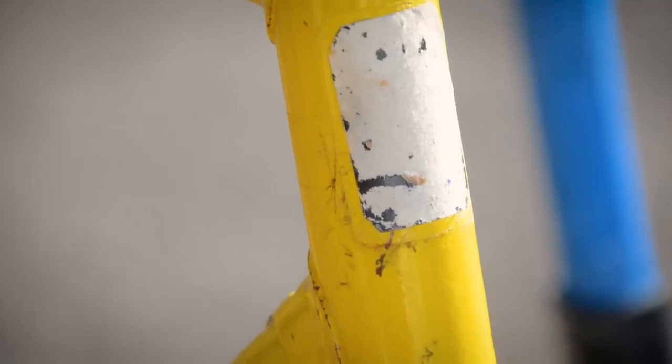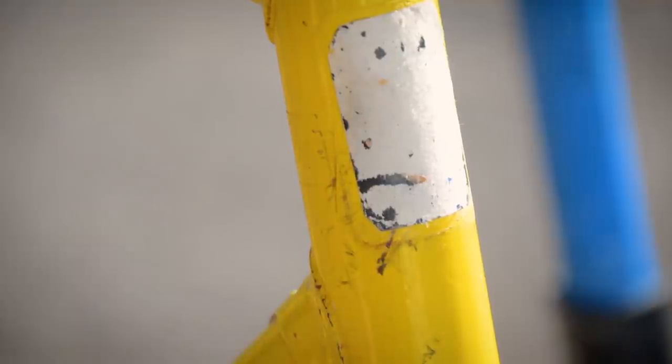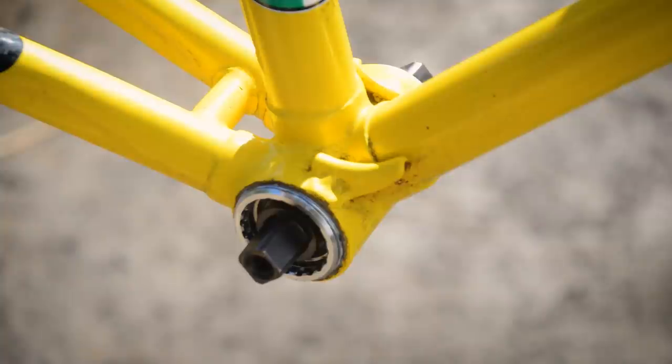Actually it has been painted — there's a little head badge underneath here. I'm going to peel the stickers off, clean up the frame, and probably work with the yellow rather than going raw steel. The only thing I can verify as Italian on this frame is the bottom bracket — that is definitely an Italian bottom bracket. The threads were disgusting in there; it looks like someone's beaten it and the shell really needs a face. The seller is just not responding to me, so that's why I decided to turn it into a fixed gear, since I'm not sure of the provenance of this frame.